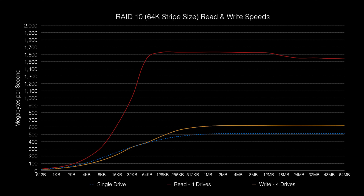Now let's take a look at writes. Here's a single SSD drive, and here's the four-drive RAID 10 array — we hit 625 megabytes per second. If you're wondering why four drives can't do any better than that, it's because unlike reads where they all read in parallel, in writes you're writing the same data to half the drives. So we can't expect the speed to be any better than a two-drive RAID 0 stripe. For performance reasons, at least on reads, there's no point in using any more than four drives in a RAID 10 array.